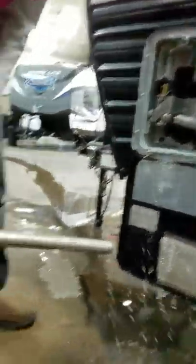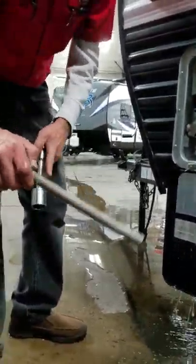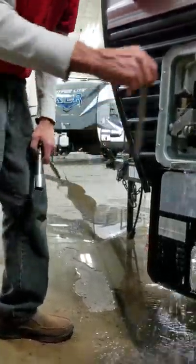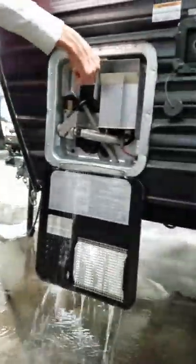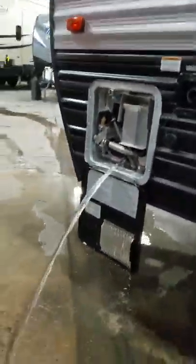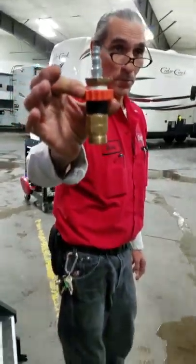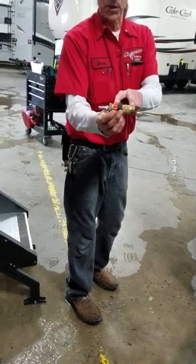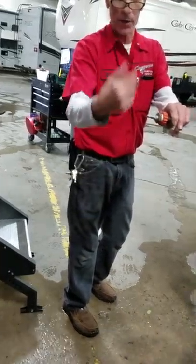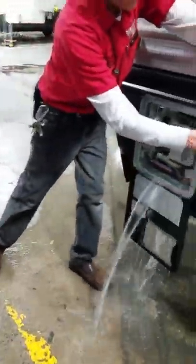See the anode rod? That little dot in the center — that's the wire. It runs all the way down there. So anywhere along there, you can see it, it's time to replace it. It's going to look all chewed up as soon as it's out. Open up that pressure release valve. Take a picture of this. That's my blowout plug. This is a regulator — this keeps my air pressure from going over 50 pounds PSI. This is getting me from garden hose thread to my quick connects to my air hose. That's going to screw right to the city water hookup, just like so.